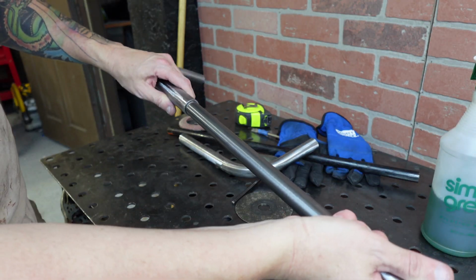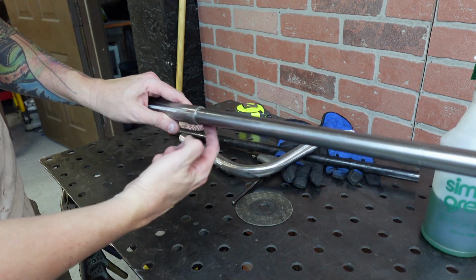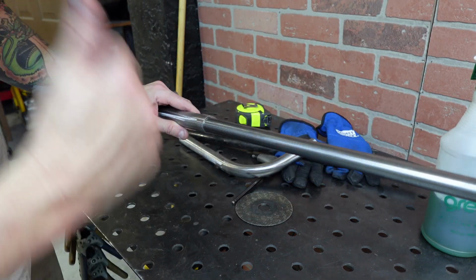So I'm gonna slide that as far as it'll allow me to go. Other side is gonna get connected. I will weld in between the two. I'll leave a gap. I'll TIG weld all of that, grind it down. That'll give me the bend. You won't even know that I did it. I hope. That's the idea, is to get it nice and flat and smooth.